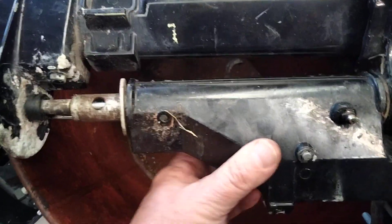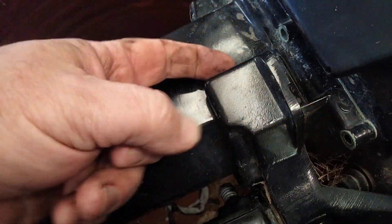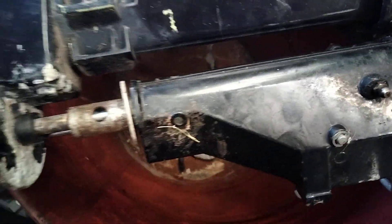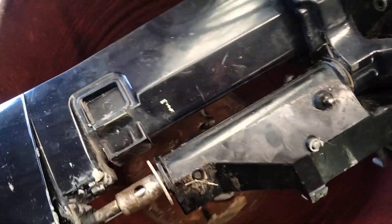I've already fixed it. You can pull the broken one away. You can get more play by moving this down. This slides on a couple of rubber bushes and you can move it a few centimetres before all the cables and stuff get tight, which gives you enough room to slide the broken one off and put the new one back on without pulling the whole thing apart.